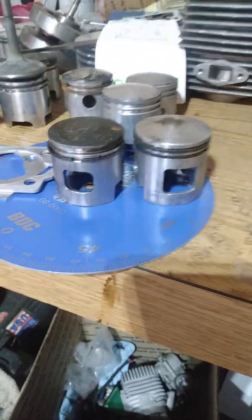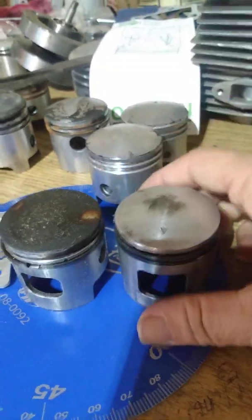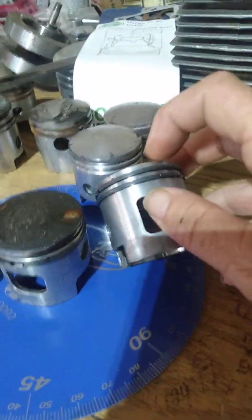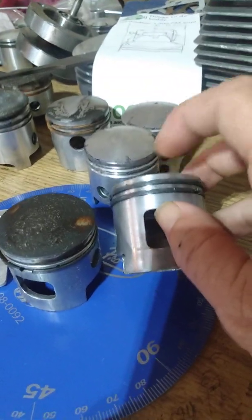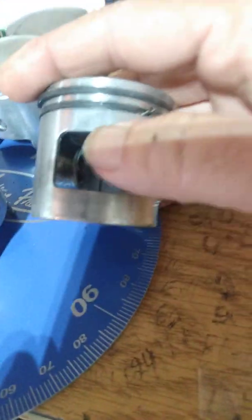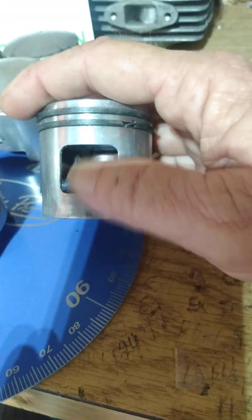Typically you need a spacer plate, and typically the piston will travel below the exhaust port — that's nothing to worry about. If you raise your cylinder too much, then your intake port will be open. But I always run reeds and make a boost port, so ninety-nine percent of my motors the intake port is open to the cylinder anyway. Window location — can't stress it enough.